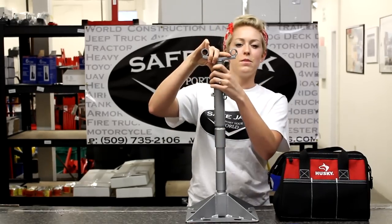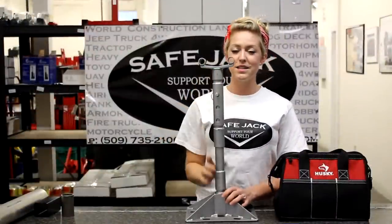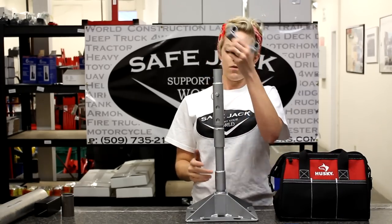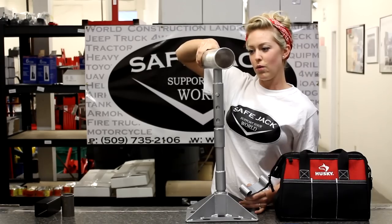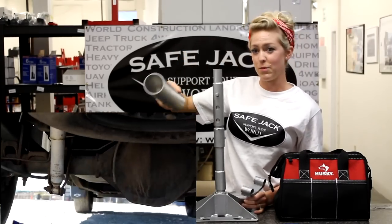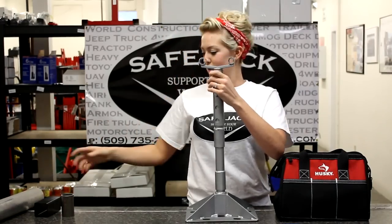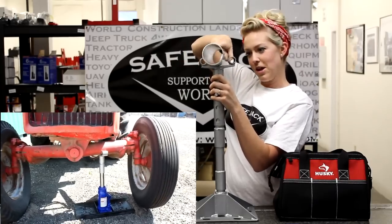There really is no practical limit to that. Adding the jack pad to the top of the jack stand steadies and supports the load and makes slipping far less likely. For instance, if you are lifting on your axle with a regular jack, the contact point is not very big — it can easily slip off, which is dangerous. With our universal jack pad, we are positively engaged.